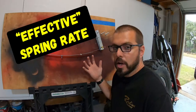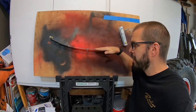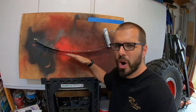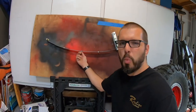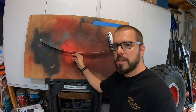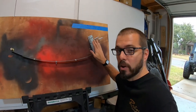Whether you're using it for a street vehicle or an off-road vehicle, the shackle setup is what affects your ride quality, your travel, and your effective spring rate. Your effective spring rate is different from your spring rate. Your spring rate is determined by the thickness of the steel, the arch, and the characteristics of the steel used.